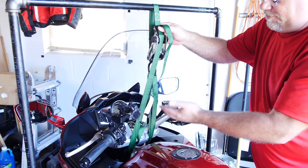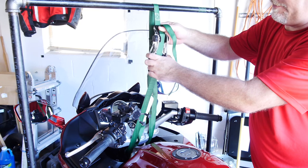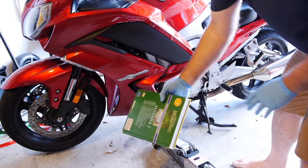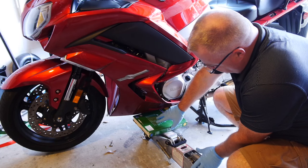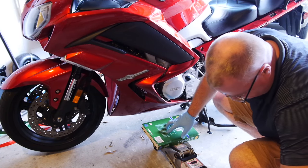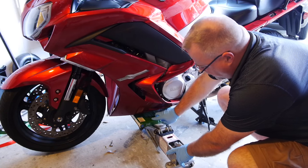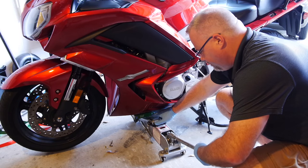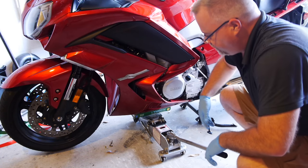You can do the same thing on the rear — I'll typically also use a second strap to make a V shape. That's using a floor jack with a textbook under the headers to protect and support them. This works really great and is fine for anything not super long-term, and doesn't damage a thing.